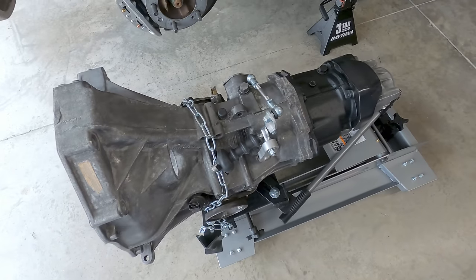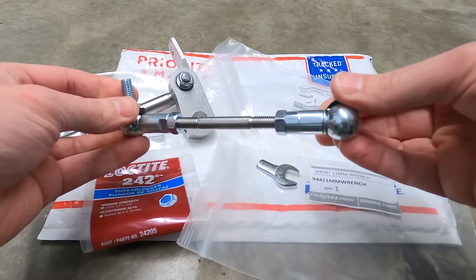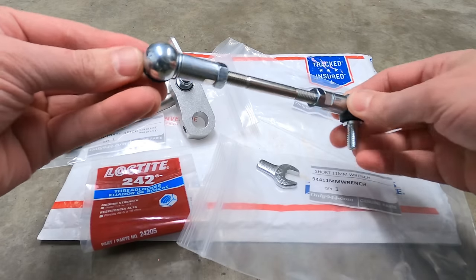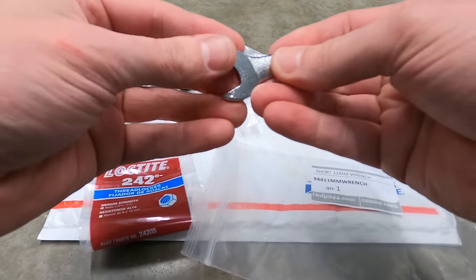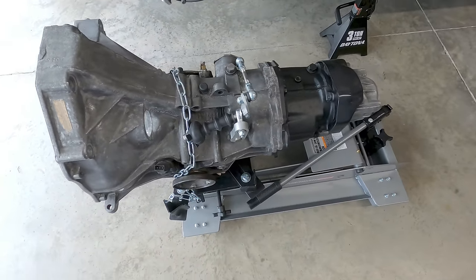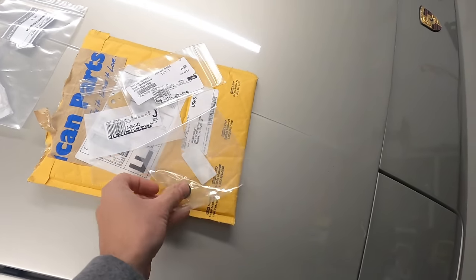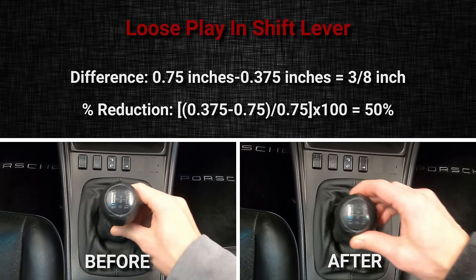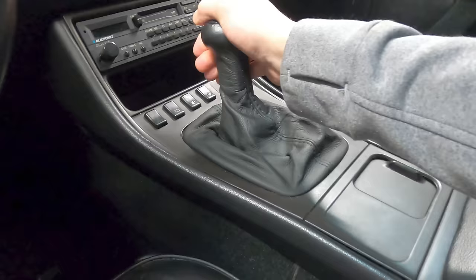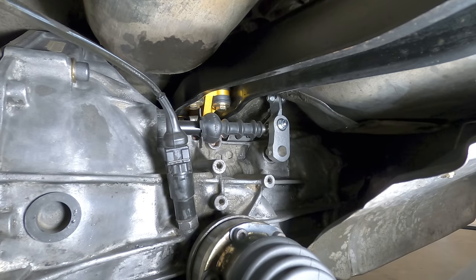Also at the transaxle, I've added a short shifter and shifter linkage arm by Only944. This aftermarket option features ball bearing connection points, where the OEM shifter linkage was designed with rubber joints that tend to wear out over time, creating quite a bit of slop in the shift lever. Installation of the linkage arm with the transaxle in place does require an extremely short 11mm wrench, so you can either cut an old wrench down to 1.5 inches in length or buy one from Only944. During installation, this is a good time to replace the leaky shift rod seals with some new ones. With the new parts installed, this setup eliminates most of the play in the linkage while also improving shifting precision and shortening the front-to-back throw distance by about an inch. The short shifter offers less resistance when changing gears, gear selection is a bit notchier and more exact, and it's a nice improvement over a worn out factory shifter.